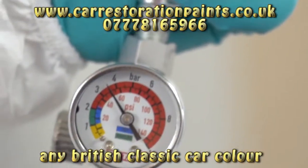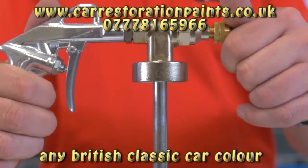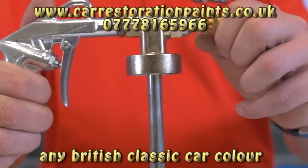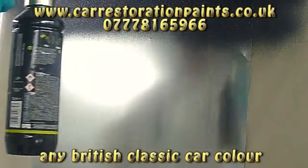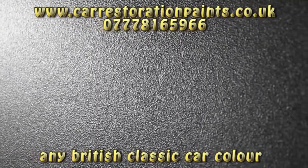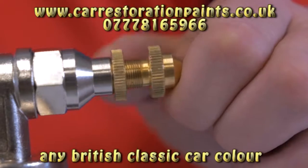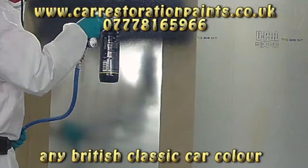The example textures shown in this video are all created with air pressure set at 3.5 bar at a distance of 50 centimeters. For a light texture, set the nozzle at two rotations, ensuring it is locked in place for consistency. Keeping the air pressure at 3.5 bar at a distance of 50 centimeters, an additional two rotations provides an alternative texture option — again, locking the nozzle in position to ensure a consistent finish.